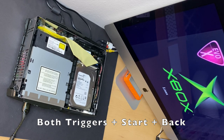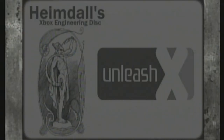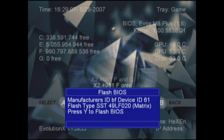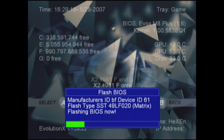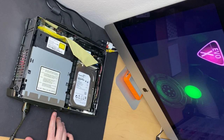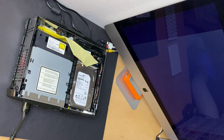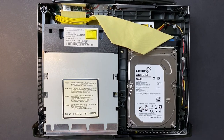Now that the Xbox is modded you can restart it with the gamepad, which is kind of cool. Navigating through the menu, I'll select mod chip flash. The one thing I will point out is that for the Aladdin mod chip you have to select the 256k BIOS, not a 512k BIOS. Even though this is an Xbox 1.0 — and 1.0s will accept the 512k BIOS — we're flashing the Aladdin mod chip, not the Xbox, so we must select the 256k BIOS. Navigating back to the storage section in UnleashX, we can now see the full terabyte.